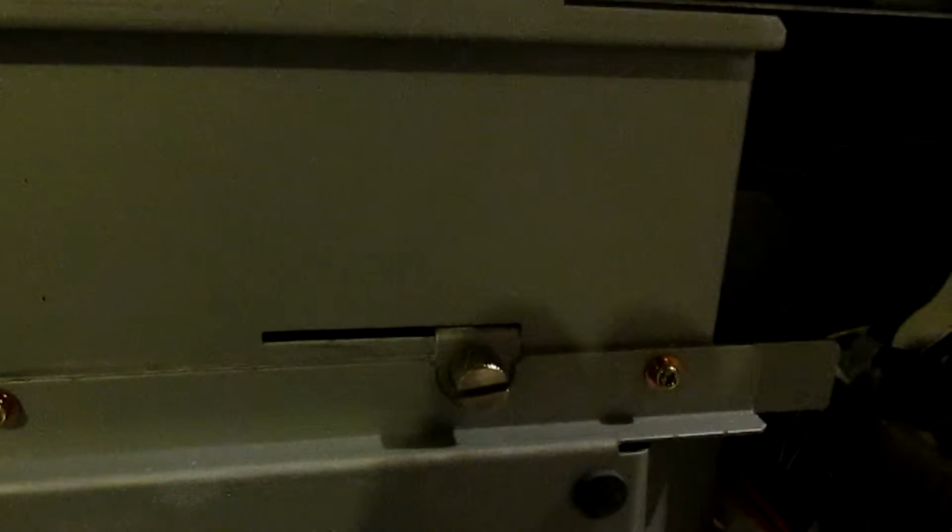The shroud is held in place by 2 thumb screws, and here's the fan. You can't really see it in there, but it goes right over the processors and sucks the hot air off of them. Now I'm just going to note one thing. Having this screw on the outside is important, because otherwise the shroud would fall off. This little piece of metal that this part connects to is not actually secured to anything. It can come right off if it so pleases. So that's not really a good thing on your part there, Toshiba. Like, come on. Alright, so anyway,